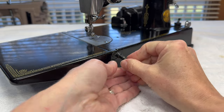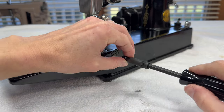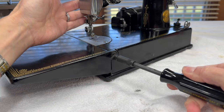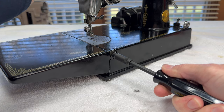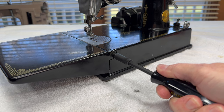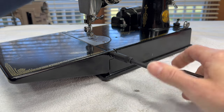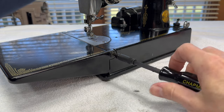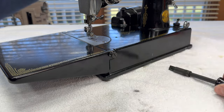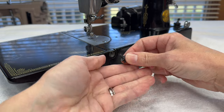Let me turn this just a little so I've got the bit that fits — this is a Chapman. These screws come out by turning them counterclockwise. I'm grabbing up high on the neck of the machine to hold it still, and then just take the screw out. When you're doing this, do it on a towel or something so your parts don't fall and bounce off a hard table onto the floor.